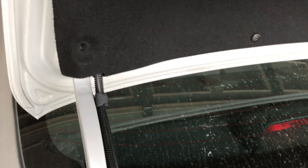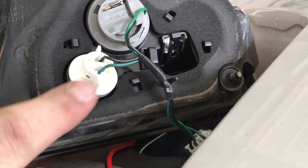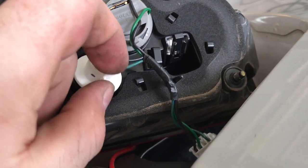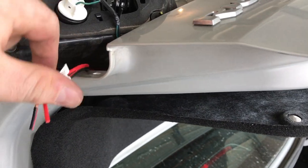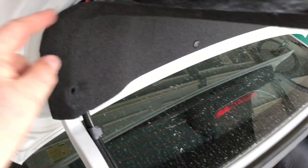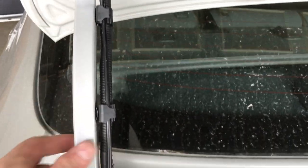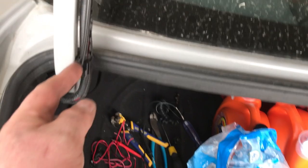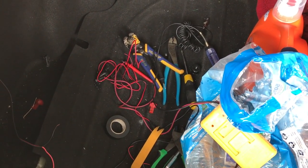For power for the camera, we popped out the backlight by releasing these clips — they're little 10mm nuts. Here on the backlight, this is the reverse bulb on the hatch: the green one is positive and the black one is negative. I ran the power and ground up to this area and we're going to tap into those. I ran this power down and tucked it inside the split loom tubing. Releasing all the little clips, you can tuck that wire into the split loom tubing, and it came out here. This is going to connect into our harness — our power and ground for our backup camera.